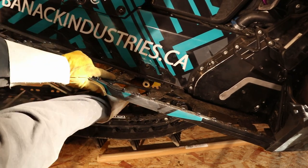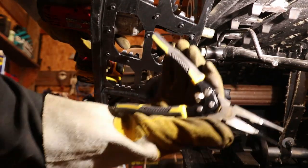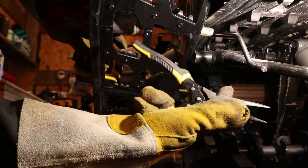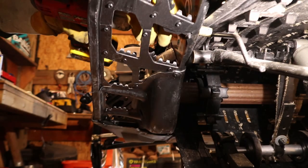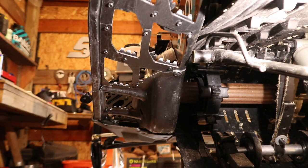Get that pull — just like that. So this is what I meant: see how the front swing arm is here, you have a collar there and then you have that rod. You're going to have to grab that rod with pliers or something and get it to come free. I used these — they're like torque-multiplying needle-nose pliers — and there we go. Just like that. It takes a little work; sometimes they come easy, sometimes not. If they haven't been apart they can be a pain, so just work at it and it will come.